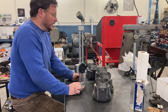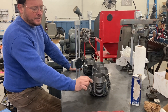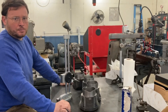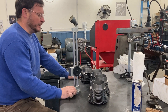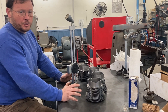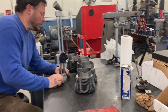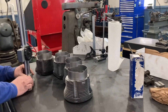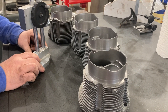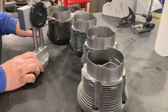We've cleaned out the fins on the cylinders, so now we're going to check that the heights are all correct to the sealing surface here, because if there's a lot of variation that could cause a problem. I'm using my height gauge right now. I've already checked all of these but I'm going to show you on video to give you a quick look at the problems going on here — checking the height at a couple different spots.